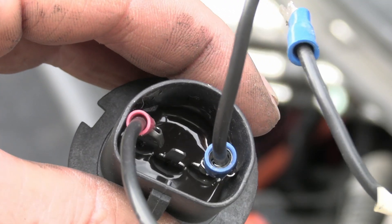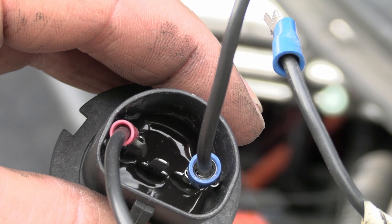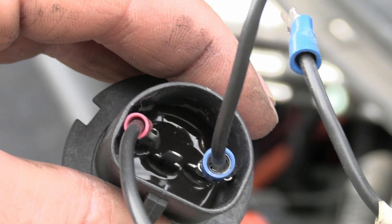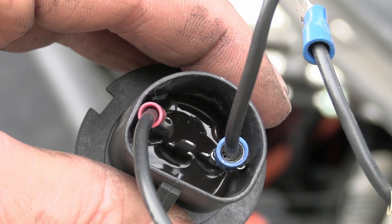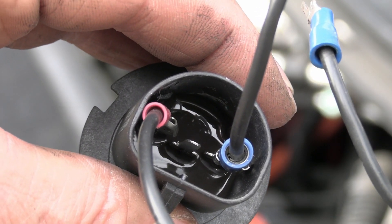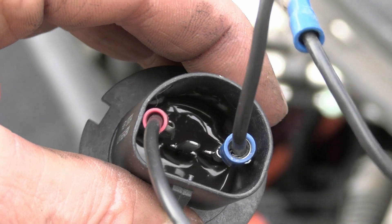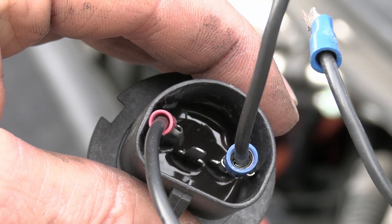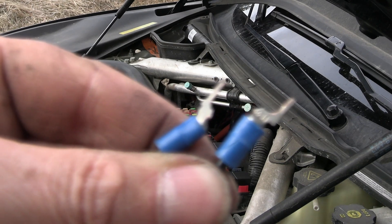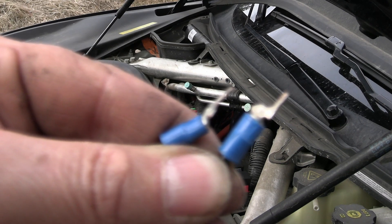So here you can see this light bulb has three pins in there, and I just had to locate the ground and which one makes the bright filament come on. If you got both filaments come on at the same time while you're testing, you're just providing 12 volt power from a battery to test it, and you just want to make sure you only have one filament come on. If you can turn one filament on and then the other individually, you just need to look for the brighter one. In this case, those are the two outer pins. So the other end — they actually had like two of those fingers sticking out and I just cut one off on each side, so it will fit into a mini fuse pin inside the fuse box.